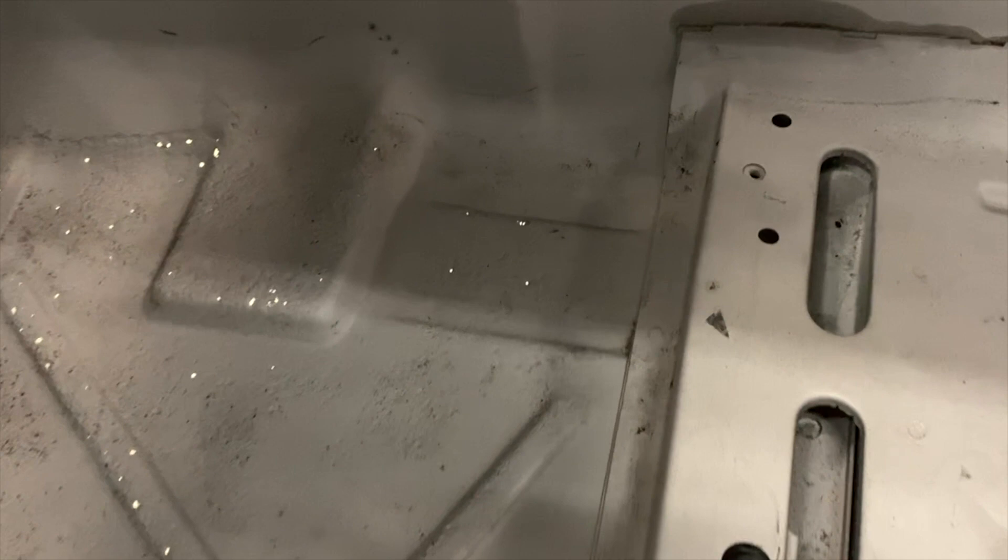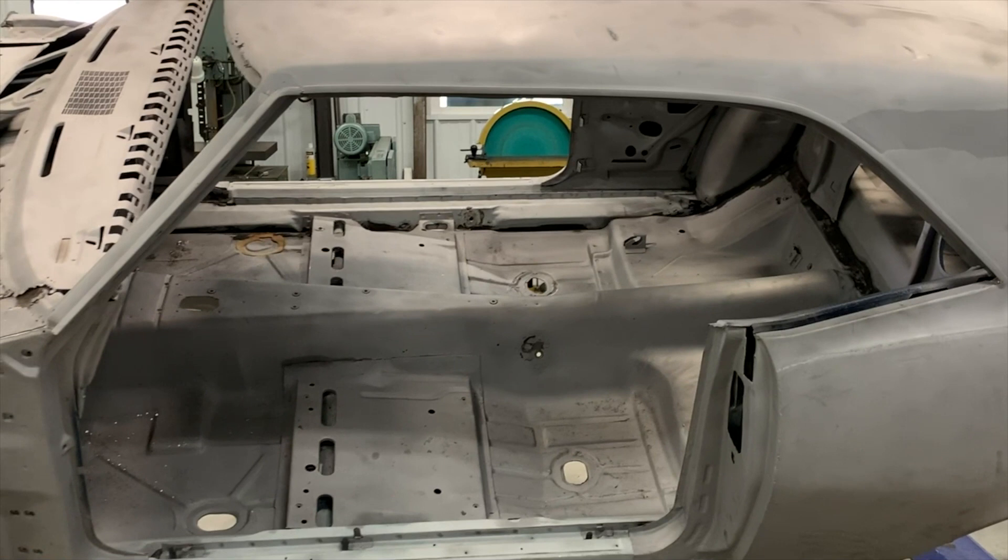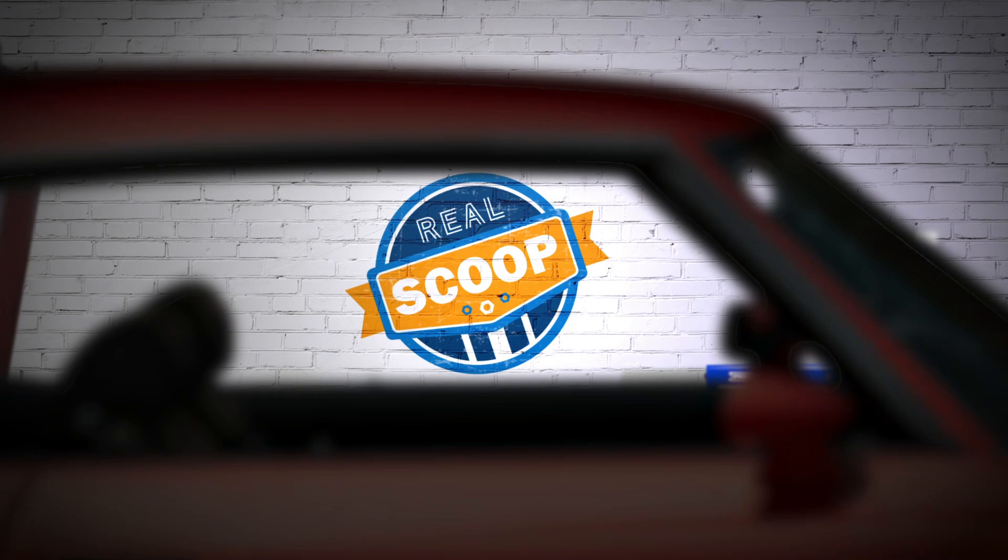The areas I'm going to do first: I'm going to cut and drill some areas in the floor pan and re-plug weld them, because the bottoms of the floor pans are still very solid so I have plenty of metal to work with. There are a couple of areas where I have too much perforation and that piece is going to be cut out and replaced. Outside of that, those are the areas I'm going to address first on my rust repair, and that'll allow me to get to the point where I can put the front frame on and weld in my frame connector.